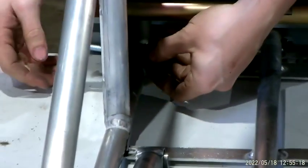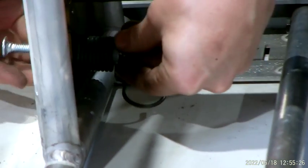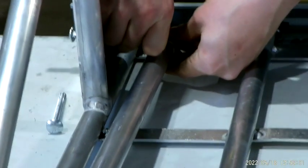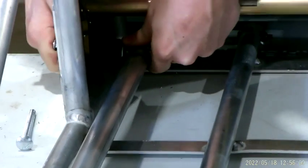I'm just gonna let it sit. This side goes into your side plate, into the hole you just drilled. So there it is sticking out the back of the hole there. And then there's no great way of doing this, but, oh, don't forget your washer. Put a washer over that. And then I like to grab this with my right hand and try to preload that. And then bring in your pull bar. And then you can just let that spring ride on the outside of the tube. You might have to move it a little bit, but you should be able to get that bolt through.